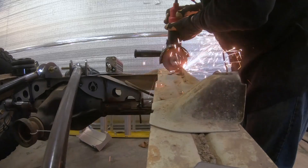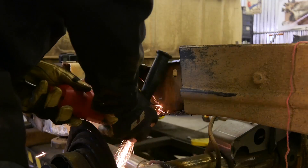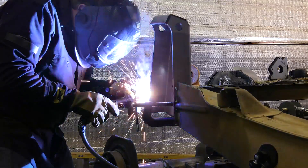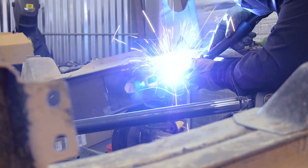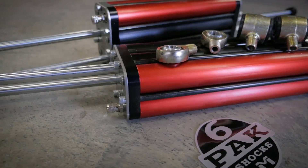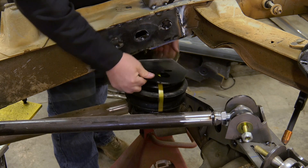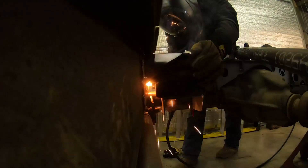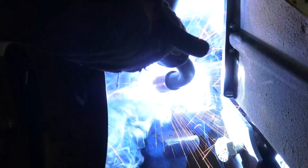The rear was just a little bit trickier because I was running out of space. There's no room for the bag between the frame rail and the tire like on the front axle, so I had to move it to the front side of the axle on the inside of the frame. It actually allows me to integrate a new frame stiffening plate into the upper bag mount and tie it all into the shock mounts from RCTech Industries. For the shocks, I'm using the Metal Cloak six-pack shocks. I like these because they package really small — only about 13 inches long when fully compressed — but I'm still going to get a huge amount of wheel travel. Once those are mounted up, the suspension is actually finished. Except for all the welding, of course.